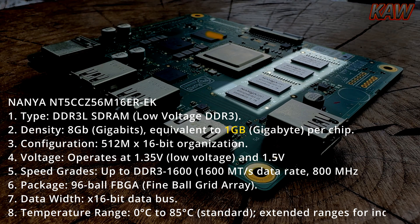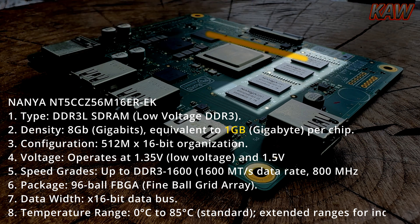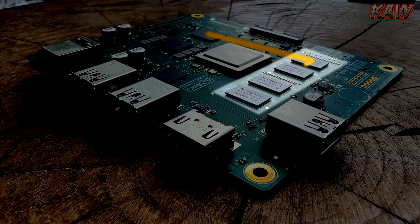This is what happens when you first boot up your PA5X — everything comes out of that 32-gig embedded flash drive. You've got your operating system, your custom sets, and it's slowly feeding the DDR SDRAM, which are one gig each, so there's a total of four gigs altogether. Once that's done, you go into your main screen, all your lights come on, and that's pretty much what happens.